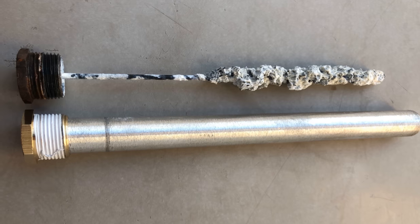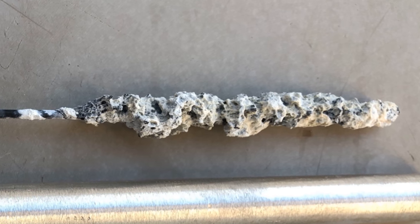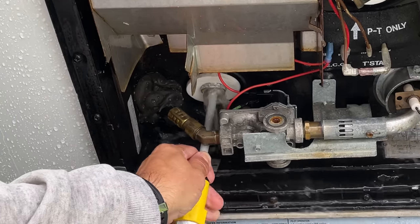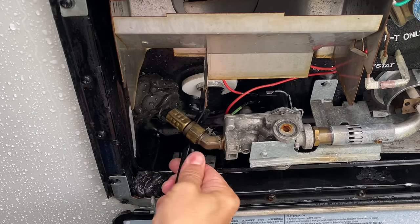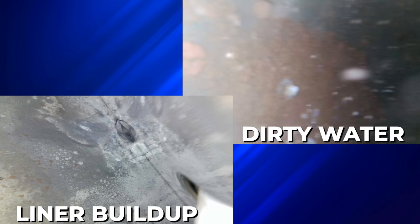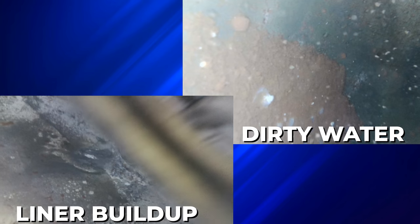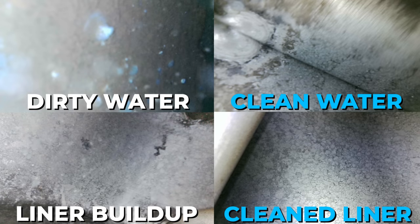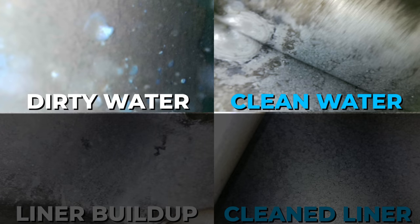I'm pretty diligent with cleaning my water heater every year so what you just saw is actually not that bad — looks like some calcium and a little bit of dirt. But for those of you with an anode rod, as they break down pieces of the anode rod can break off into the tank, so if you have a Suburban water heater be prepared to see a lot more debris than I did. In a second we're going to run the borescope through the water heater to see how well this process works, but first I'll hit the water heater with the cleaning wand one more time and then brush the threads of the tank drain so any loosened solids don't get stuck and prevent a perfect seal. Here's footage of the water heater before cleaning — solids, dirt, and build-up from just one year of camping — and here is footage of the tank after it's been cleaned. The tank liner looks much better and the water is much clearer now that we've gotten everything out.